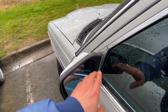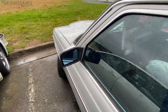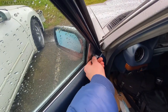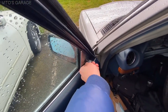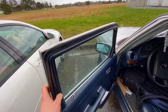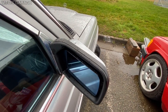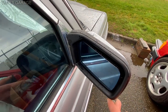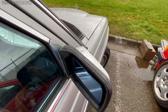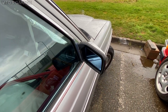Next thing is the mirrors. The mirrors were frozen when I got this car; right now everything moves nicely. I'm about to show you how this operates — it's really nice and easy. No issues whatsoever. Before, it was actually really bad, so I had to take it all apart and lubricate it. I did the same thing to the electric mirror on this side — I lubricated it with ATF and right now it moves really well without any issues, which is a really big plus.